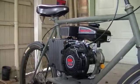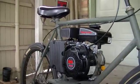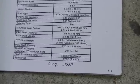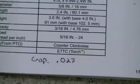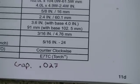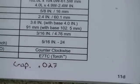The spark plug is right there directly underneath the muffler. The original spark plug — let me pan down and show you — this is the specification sheet that came with the engine. The factory spark plug brand is called Torch, part number E7TC. Before I ever started this engine I pulled the spark plug out and checked the gap, and I wrote it down: it's .027 spark plug gap.